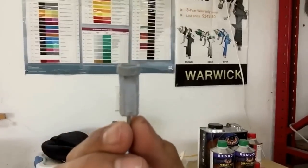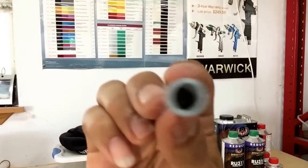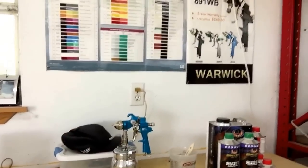I couldn't figure it out until I dumped everything out of the cup, trying to take apart the gun to clean it. I thought it was maybe dirty inside, and then I was like — oh, the filter. When you're shooting thick primer like that, you want to take the neck filter out. I took it out and threw it, I was so pissed. You know those little neck filters? This thing was clogging up and it just totally screwed me up. You can see it's all dried out.